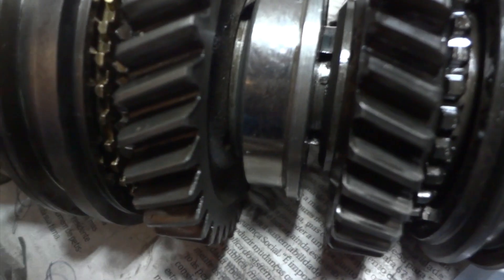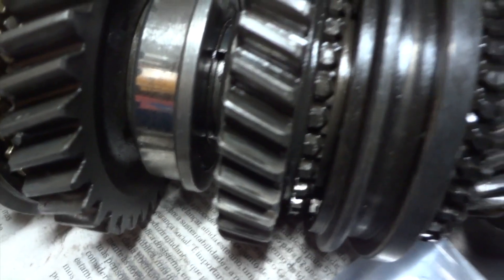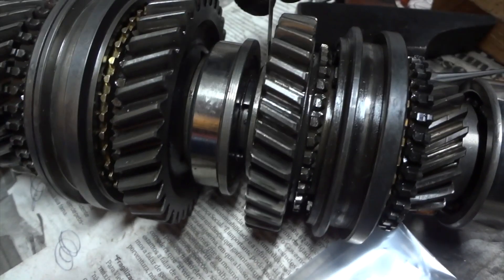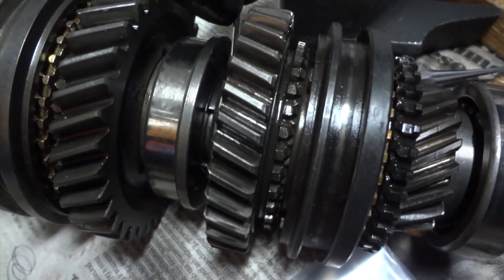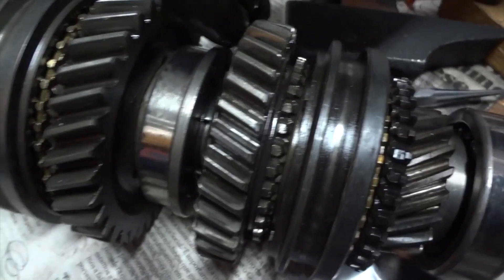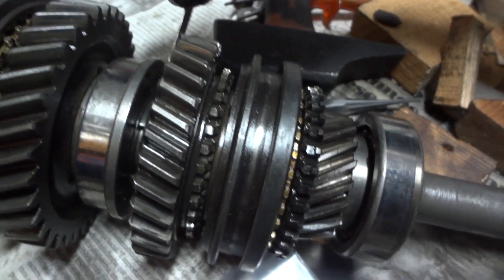For the reverse gear — the reverse gear is the one without the synchronizer. It's the only gear without the synchronizer. So we tried to get the blade in there, and it almost fits, but it does not fit. The maximum tolerance is 0.6 for this one, and I'm using the 0.5 blade, so it's also okay.